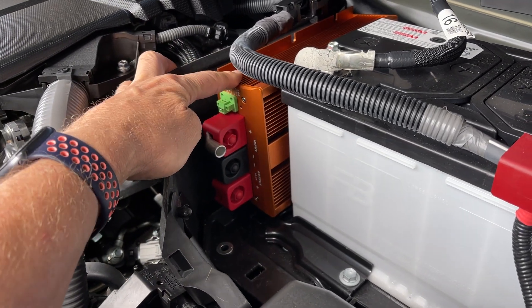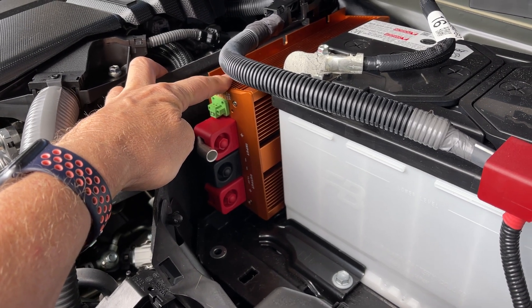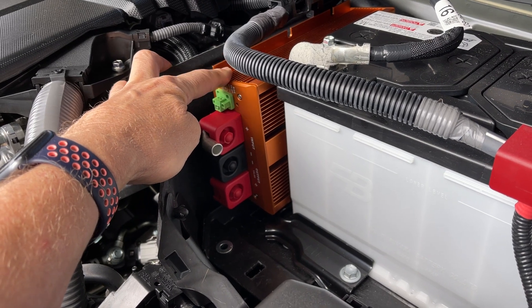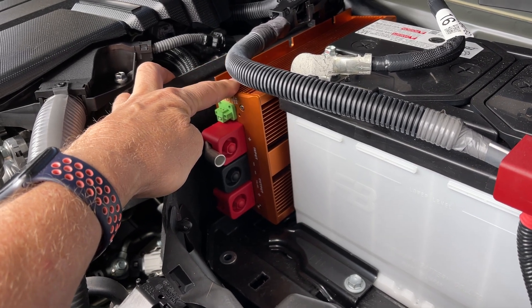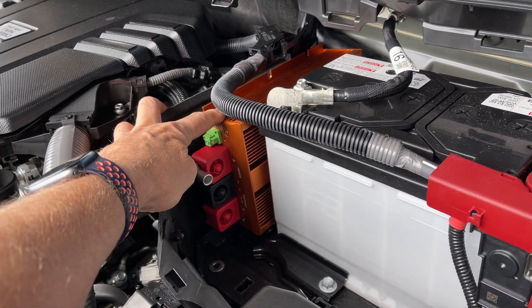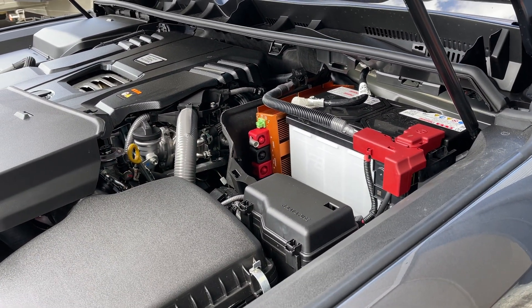This is a 12-to-12, 80-amp — that's double the nearest competitor. The competition fades; one of the green brands will actually go to half power once it gets hot. This one will not. This is a planar high-frequency unit — it will just keep putting out 1020 watts non-stop, all day long, charging in the back. And it all fits in there, looks like factory. How good is that?